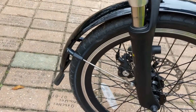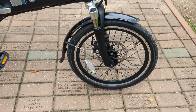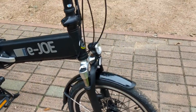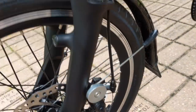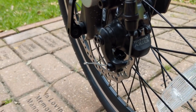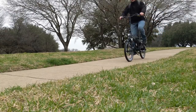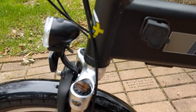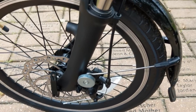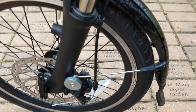It includes plastic adjustable fenders, which are nice. But really, one of the best features of this bike is the disc brakes. They're pretty basic Tektro Ares on a rotor — economy class, just basic, but a nice big rotor and you can definitely feel the stopping power. They are mechanical disc brakes, which is actually a lot easier for maintenance and adjustability than hydraulic. I don't feel a major difference in stopping power between mechanical and hydraulic disc brakes.